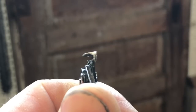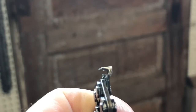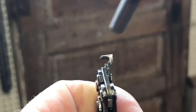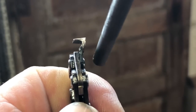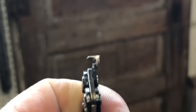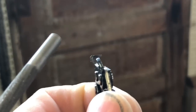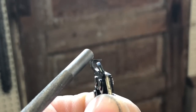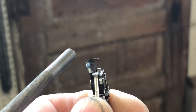And I've got a couple here I'm going to show you real quick, so hold on. Okay, so what we're looking at here is the back side of a cutter on a full chisel chain. And if you can see what I was talking about when I was explaining it, you've got the flat part of the top, and then it comes down at a 90, creating that L, sharp, very square edge there. What that translates to on the front of the cutter is a very sharp point. My camera's going to lose focus, of course. But anyhow, right in there, it's just so hard. I don't know if any of you have ever tried to photograph your chainsaw teeth.